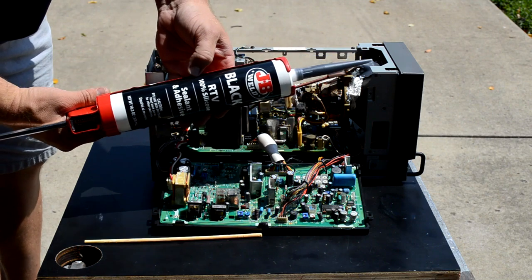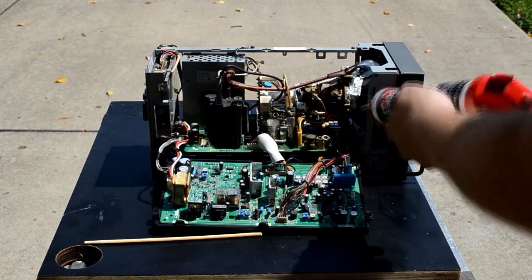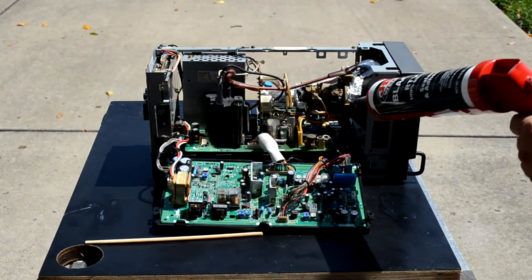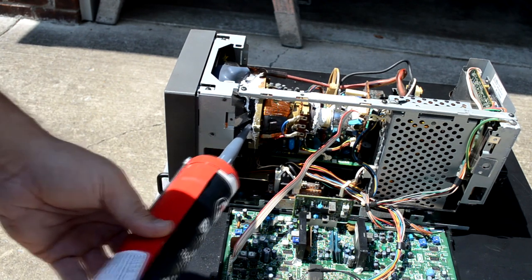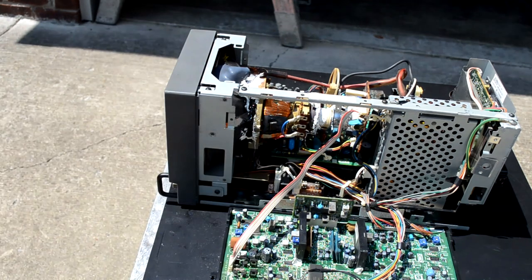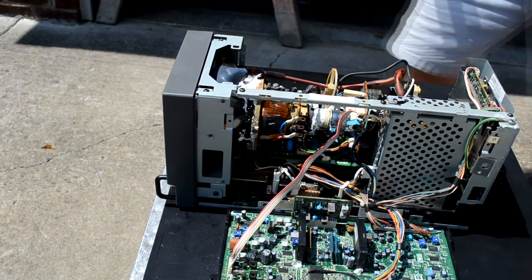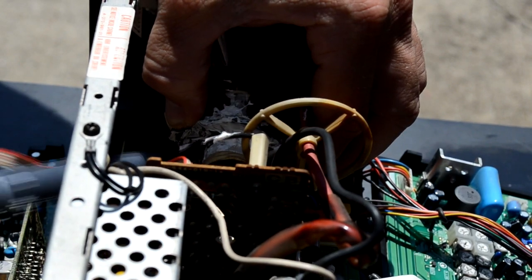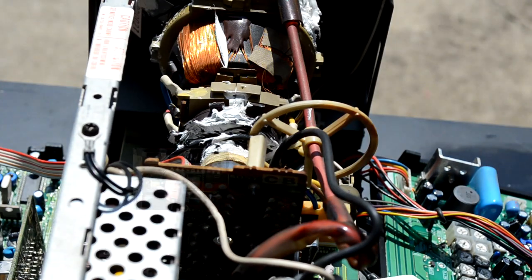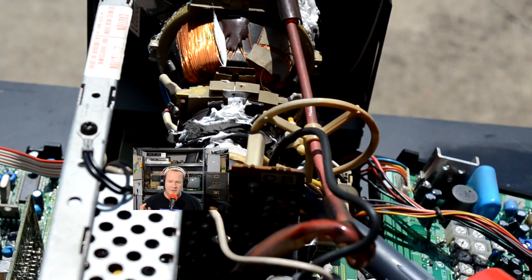Now this is the silicone. Prior to the footage you're seeing here, I have used some white silicone, and now I'm going in with the black RTV silicone to fill in all the gaps and pretty much build up an entire silicone membrane to protect the tube and the yoke and have the yoke sit in the proper space. The RTV is heat resistant and is generally used to make gaskets in automotive repair, so it's very high quality and will definitely work for us here. I've already used some of that white epoxy and it's had a little bit of a chance to harden, so now I can go in and apply the second layer of RTV to fill in the gaps, then let it harden after I get it applied evenly through this neck.